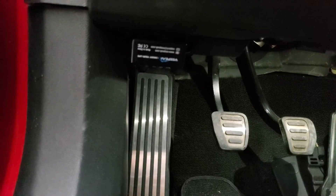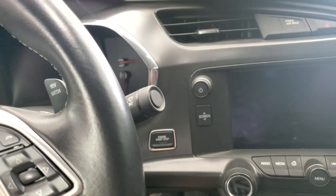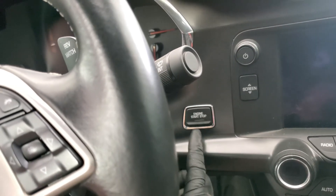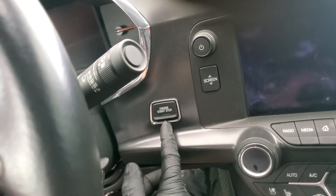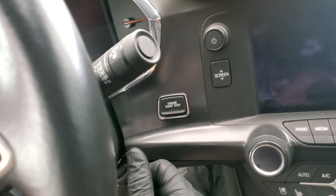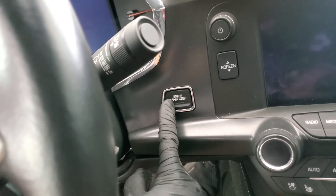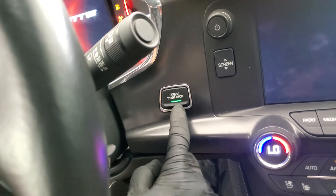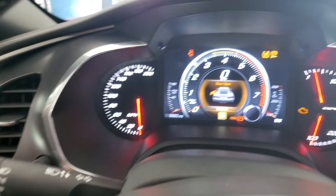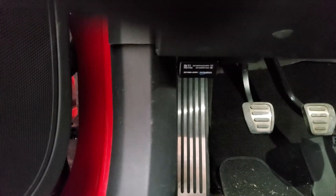I plugged in the sensor into the car. Once it's plugged in, you have to turn on the car — you don't have to start the engine, but you do need to make sure it's powered on. If you have a key, the first click turns on the lights, the second click turns on the car's computer, and then you start the car. For us with the push button, we know it's working when we have the green light. Now we have the green light, the car is started, there's the check engine light, and now we're going to connect to the OBD reader and see what the problem is.